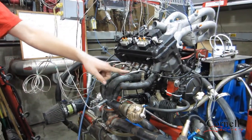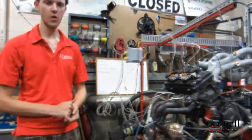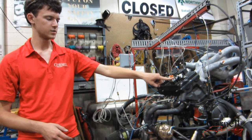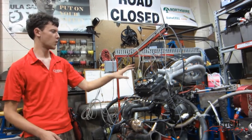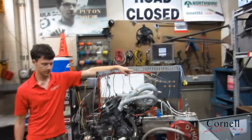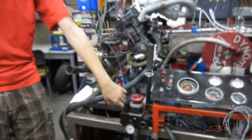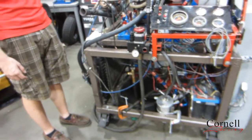The four EGT exhaust gas temperature sensors are here, wired to this box which then goes to the MCC DAC. The four exhaust pressure sensors are wired up through the head, where there are small ports that go down into the exhaust ports of the head. These four lines go over there, which is where the pressure sensors are located. The oil pressure sensors — one is off here and one is down there — are positioned before and after an oil restrictor, which then goes to the turbocharger.